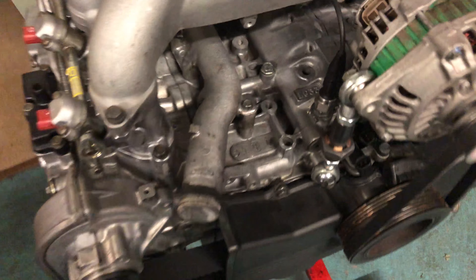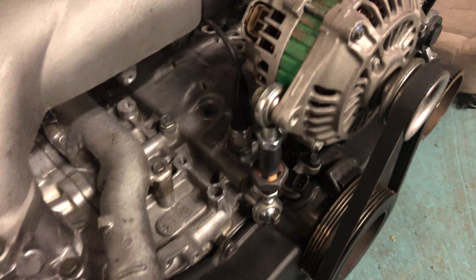This right here is the flapper valve — at low RPM it divides the intake halves, and at high RPM it opens up and combines them. I don't feel like tuning that into the MegaSquirt, so I'm just gonna cut it off and delete it. For the alternator, a buddy online made this adjuster so you can tension the belt. I also got this oil pressure sensor — three wires, one going to the MegaSquirt so I can monitor oil pressure. I'll have the same thing for fuel pressure, mainly for diagnostics, data logging, and seeing why my engine blew up after it's already too late.